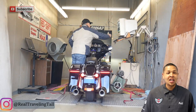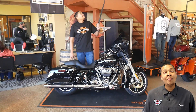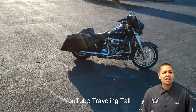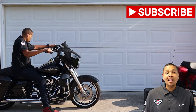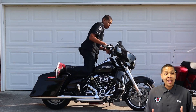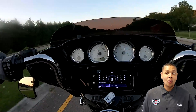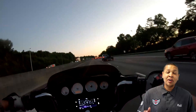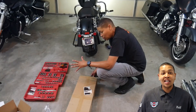For the new subscribers and viewers, let me give you a brief summary of my motorcycle. It's a 2019 Street Glide that started out as a 107, with about 107 foot pounds of torque and 78 horsepower. After owning it for around six or seven months I upgraded to a Zippers Performance 124 kit — a Zippers Performance sleeper kit that makes 150 foot pounds of torque and 130 horsepower at the rear wheel. There are a lot of other things done to the bike for suspension, bars, and other things, and you can watch all those videos of the upgrades done to my motorcycle.